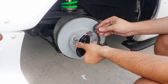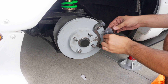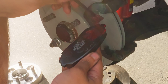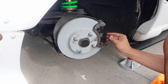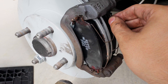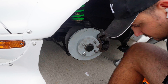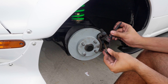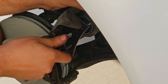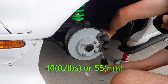After those are torqued down, grab your pads and some high-temp grease. Put a little bit on a brush — you can use any sort of brush, a paintbrush or whatever, as long as it gets onto the pad. I'm going to do the two small sliding points on the ends of the pads. Obviously you don't want to put grease on the pad surface that contacts the rotor, but do grease up those sliding points. You can also grease the back of the pad where the caliper makes contact. Then pop in your retainer clips — they're a little annoying, but once you get them in it's kind of self-explanatory. These hold the brake pads away from the rotor so you're not constantly rubbing. Next, slide the caliper back on. Grease up the bolt from the bottom of the caliper. I have a tool from Amazon that presses the caliper piston back into place — it makes it a lot easier to slide, especially with brand-new pads. Then torque to spec — I'll pop the torque specs on screen.